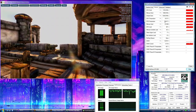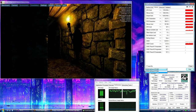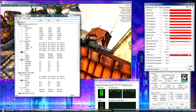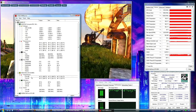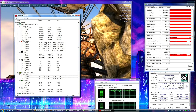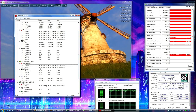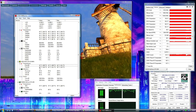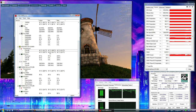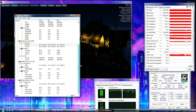Oh yeah. We just hit the one there, one GPU. While we're at it, we can check the temperatures of the CPU of that report, and then it reports around 42 to 49. One is hotter. But like I said earlier in the video, increasing the vCore makes this skyrocket to like 95, I've seen as the highest. And that was just below 1.5 volts. And that was in Prime95. It usually doesn't skyrocket in normal programs.